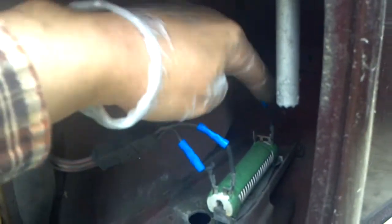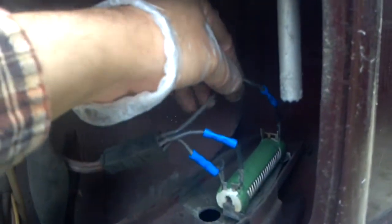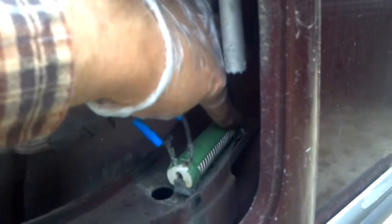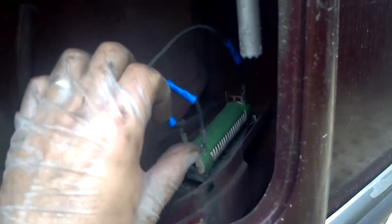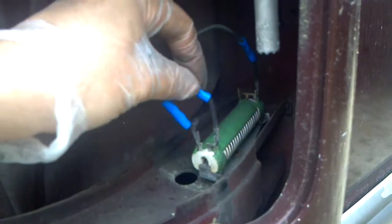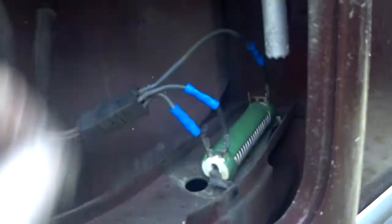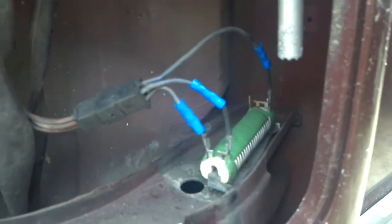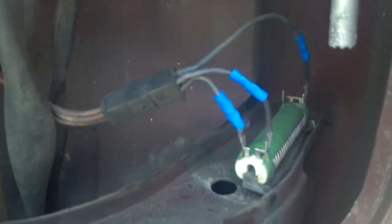We got this new resistor all spliced in. When you go to splice it, really the only one that matters wire-wise is the one farthest away from the plug — there's one on one end all by itself. You want to splice that to the same wire that has one on that far end on the old plug. Leave maybe about an inch on these wires so you have something to splice to. I usually use crimp splices — I know people don't like them, but give them the pull test: if they don't pull out, they're good. That's what they use in the aviation industry; they do not like soldering because it will crack over time with vibration.